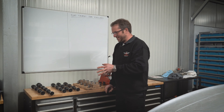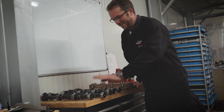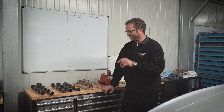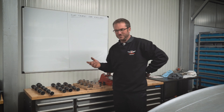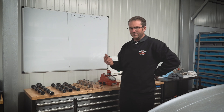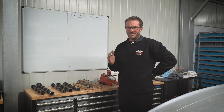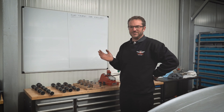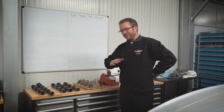There are many reasons for this kind of failure. One thing could be that the bedding procedure wasn't properly adhered to, which is quite important especially when using a slightly uprated or race cam. When bedding in, you need to coat the camshaft completely in assembly grease. We use the Driven assembly grease. The other thing is a high zinc bedding-in oil, typically a non-synthetic 30 weight - you can get motorsport bedding-in oils. Then when you run the engine up for the first time, take it straight up to 2,500 RPM and fluctuate between 2,500 and 3,000 RPM. Ideally on a rolling road, because you don't want to glaze the bores either - you want to put load on it, accelerating in top gear from 2,500 to 3,000 RPM and back again.